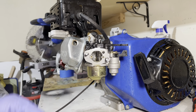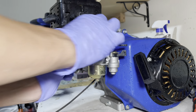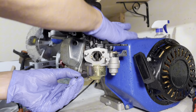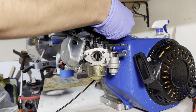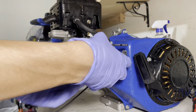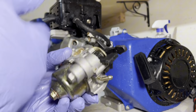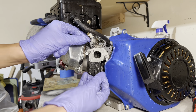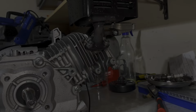Your carb should have some type of throttle cable linking it. Since this engine is governor removed, I have a spring here. You could have some other throttle linkage — it would be an 8mm bolt to remove that. After you have that removed, here is your carburetor, which delivers the fuel into your engine. We'll be taking this apart later. Set it aside along with your gasket and spacer, which has a gasket on both sides.